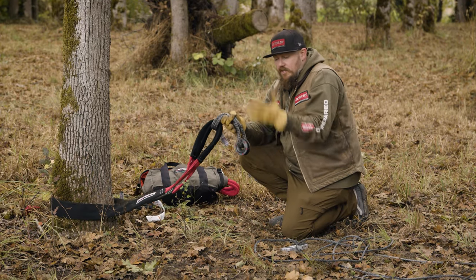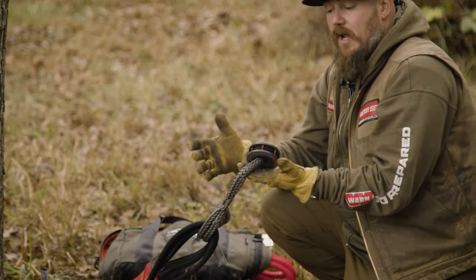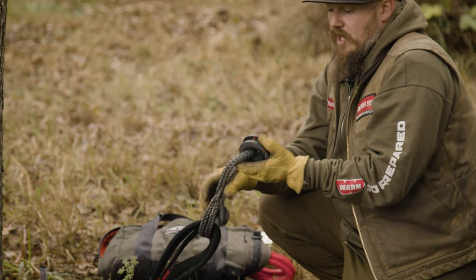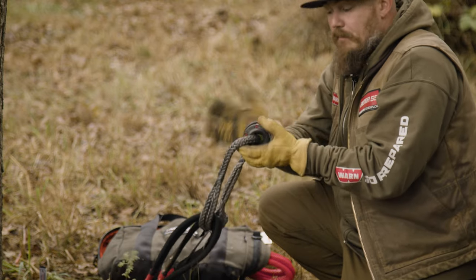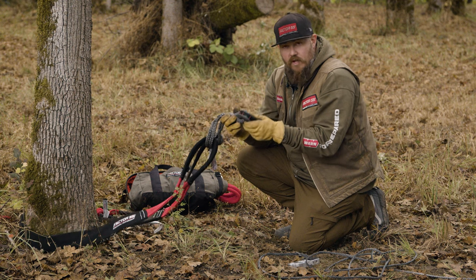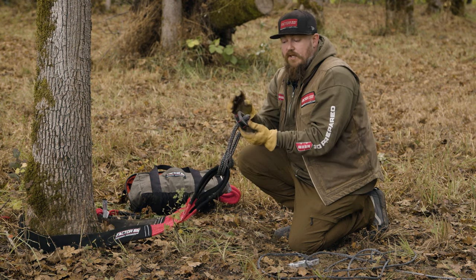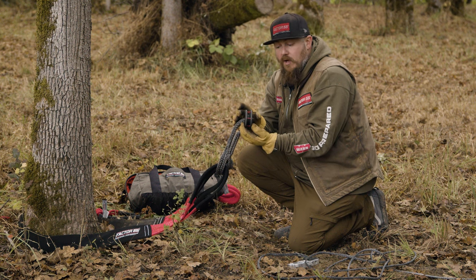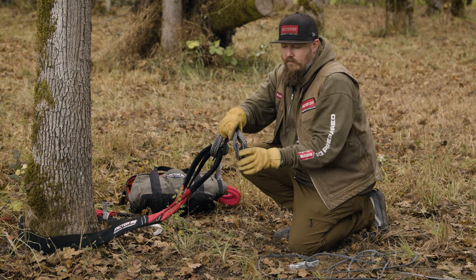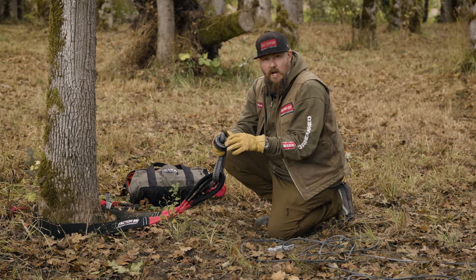What's really great about this is it doesn't weigh anything — it's super lightweight. You don't have to deal with undoing and re-screwing a shackle pin or worry about pinching your fingers with a heavy steel snatch block. Another unique feature is the larger inner radius, which keeps the legs of the soft shackle from dragging on the ends of the pulley while under load. It's also been impregnated with Teflon, making it even slicker against the mil-spec type 3 hard anodizing.